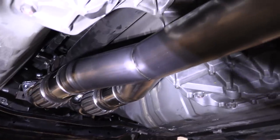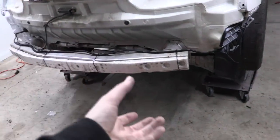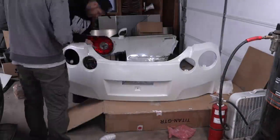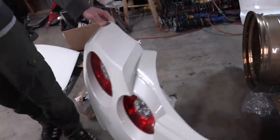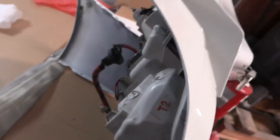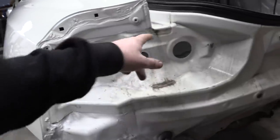We installed our second piece of downpipe, and then that goes into the mid-pipe. I didn't put the clamps on yet — I want to keep everything fluid, able to move around as we install pieces further back. Moving on to the back, we need to go ahead and mount our bumper so we can mount our rear bumper lip and figure out where our exhaust needs to land. To mount the bumper, we actually need to mount the tail lights into the bumper first. There are four bolts on each corner. You're going to want to take the little nuts off the things that poke through to mount the tail lights into the body of the car, and then also install our bumper clip on the rebuilt side.